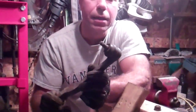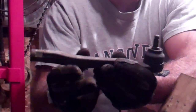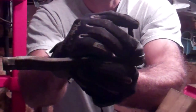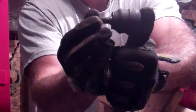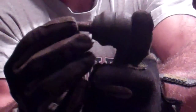Here's an outer tie rod end. Just to give a very brief description: it moves back and forth like that. The reason being is that as the vehicle is moving along and hitting bumps, these tie rod ends are going up and down — they have to be able to change their distance a little bit. Now this is a really badly worn tie rod end. As I pull that in and out you can actually see it moving. What happens is the metal on metal of this ball in here, as it wears — even though it's grease packed — eventually the grease stops getting in around there.